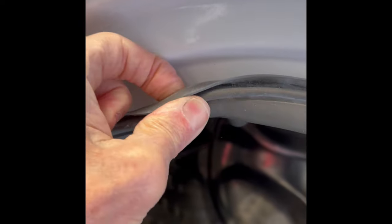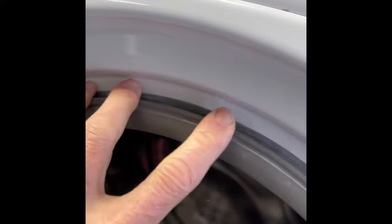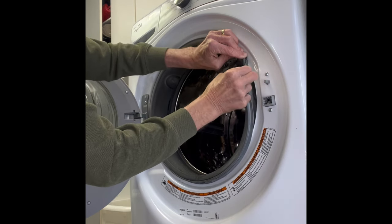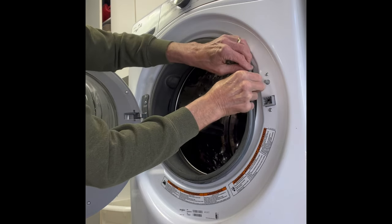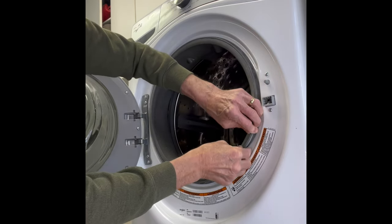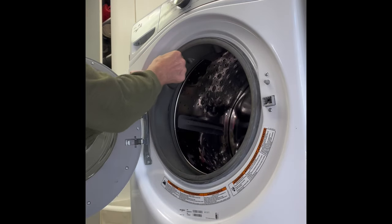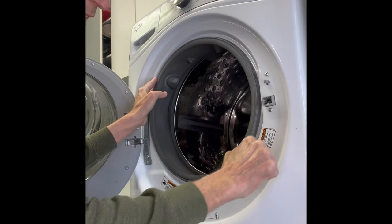You could use any kind of oil, but I like to use liquid laundry detergent because it's pretty slippery. I'm going around that perimeter using one hand to pull it out and the other hand to push it over the ridge. Some people say putting the clamp on hurts their fingers, but if it does, you can also use a flathead screwdriver to help get it in for more leverage — it depends on the model how tight the spring clamp is.